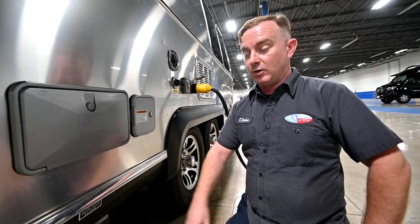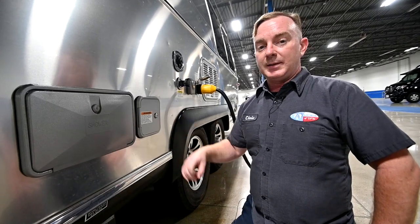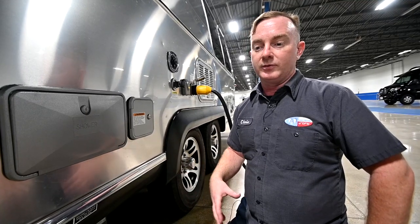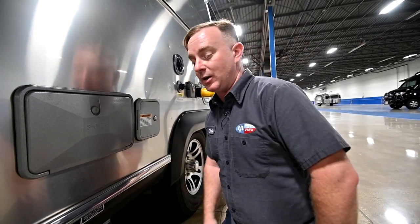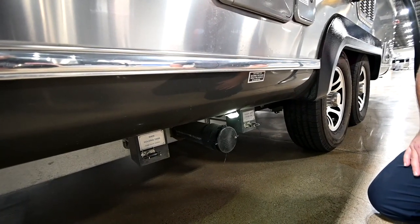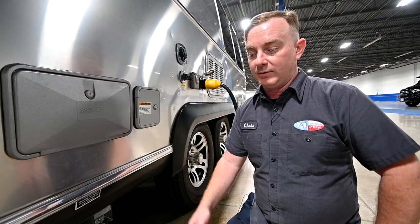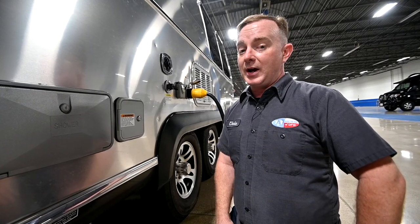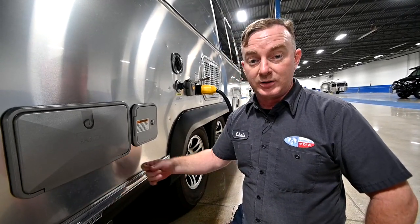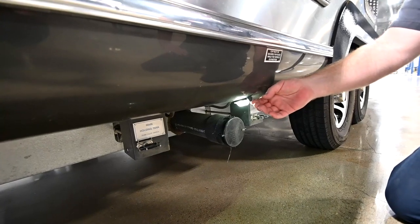Once it's as clean as you can stand, close the valve and continue to allow water to backfill until it reads about five percent on the waste gauge. Then you can go inside and throw your tank chemical into the toilet — there'll be water inside the tank to help that dissolve and diffuse. Come back outside and do your gray tank second; that is going to be mostly soapy water from your sinks and showers and it's going to help wash this pipe out. Do not open both valves at the same time — if you do the black tank will flow into the gray tank and contaminate it. Do not leave your valves open at your camping site. Were you to leave the black valve open, the water you need to help flush solids will run out, causing waste to dry out and smell. Less important for the gray tank, but if you leave that valve open, insects or rodents could crawl up inside there and build a nest in your onboard tank. It's fine to leave your sewer line attached if you have the ability to do so, but keep the valves shut until you're actually emptying the waste.